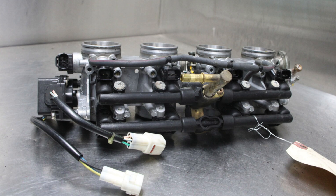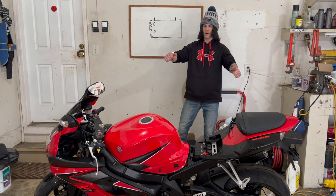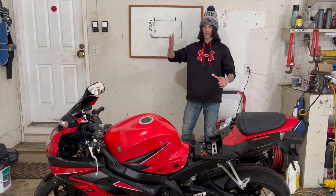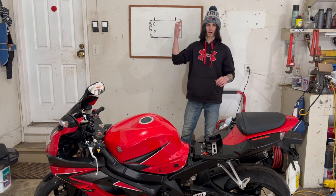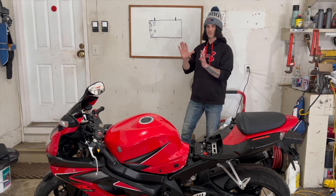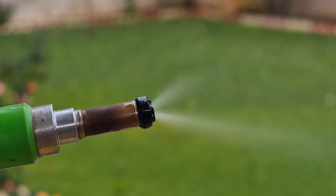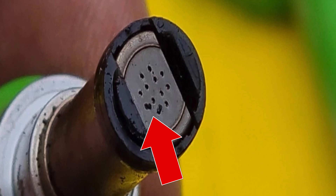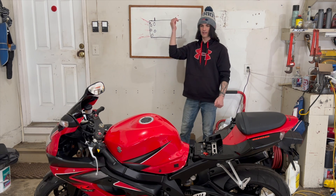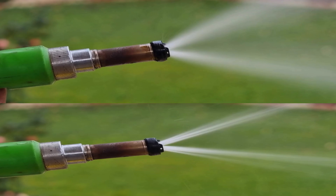Where you'll find the fuel injectors — if you look at the throttle bodies, you're going to have two rails directly behind them, an upper and a lower, called our fuel rails. Pull those and pull out the injectors. In this case we have eight and you're going to have to pull them all out. With fuel injectors, you can't just blow through them — that's not how they work. They're opened up by an electrical current; you need voltage, your battery will work fine. You need a cleaning source — carburetor cleaner works great — and you need a way to seal that cleaning source to the fuel injector so we're not losing pressure. It's basically a simulation of the engine on. It's pretty common for fuel injectors to get clogged — you'll get a sporadic type of spray and that's going to cause you to run lean. It should be a nice, even clean spray. That's why you pull them all out so you can test them all and compare them to each other.